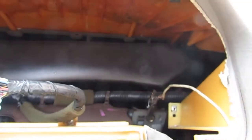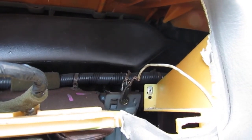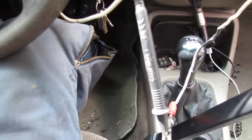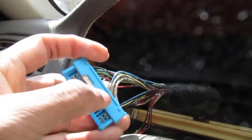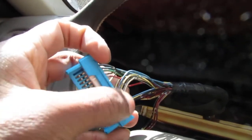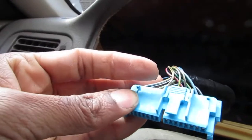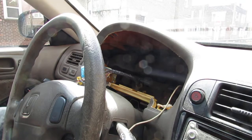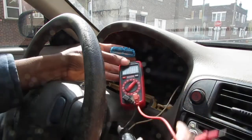All right, so we're going to use our multimeter and do a voltage test to see what's happening on the inside on that connector there. All right, so that's connected to the ground, either through an alligator clip on that bolt right there. That wire is, that's this right here, negative side. And then we're going to probe this wire right here, this white and blue wire. It's the sixth slot over, so you gotta count 1, 2, 3, 4, 5, 6, and we're gonna see what the voltage is on that and if that fluctuates or not. Keys in the on position right before you crank it, right? We got our multimeter and volts set in. I don't know how this is gonna work.